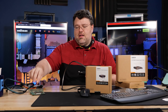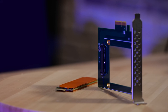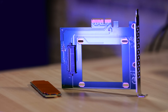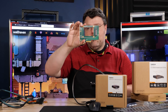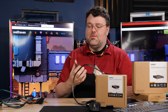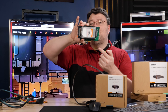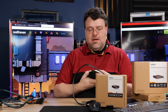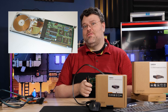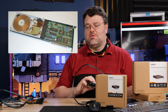The easiest way to deal with that is to get an add-in card like this one. Not all of these are PCI Express 4, but they're more readily available than PCI Express 4 cables. What you can do is actually mount your Kioxia U.2 drive to this PCI Express card and then install that in your computer. If you're old enough, you may remember the hard cards of the 1980s — this is basically the U.2 equivalent — and the only reason we have to do this is to maintain PCI Express 4 signal integrity.